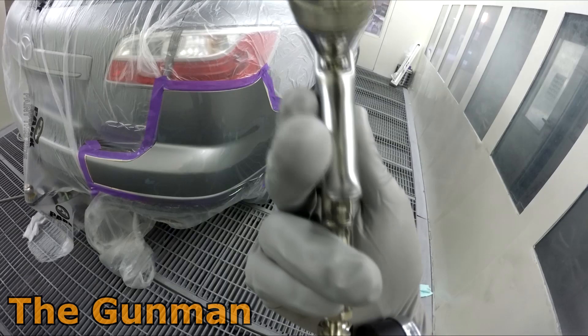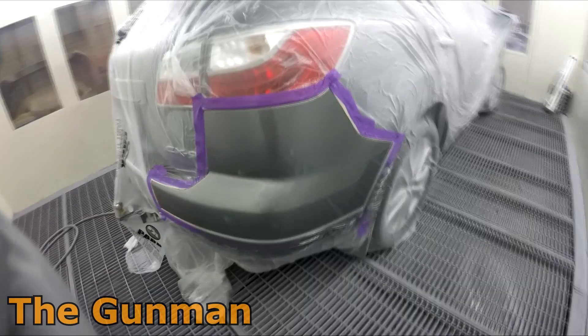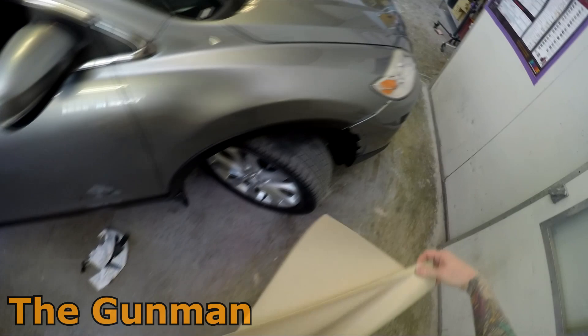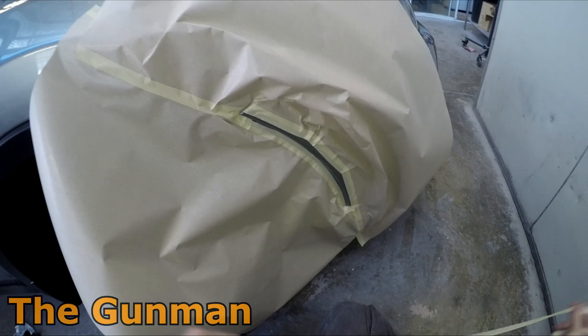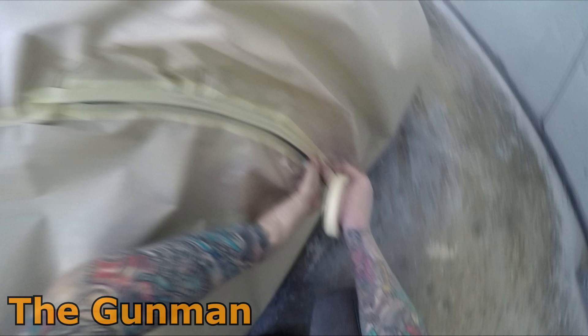This is really just a short review — I'm going to take my time when I do the top 10 mini gun review, it might even be two or three months away. I really want to put those mini guns through their paces, find out their strong points and weak points, before rushing to give a gun a number one position and finding out a couple months later the pot cracks or it's poorly built. For me, this is really where the LPH-80 shines: absolutely tiny little spot repairs. With the 0.8 tip you'd have minimal overspray and minimal material, which is exactly what you want.